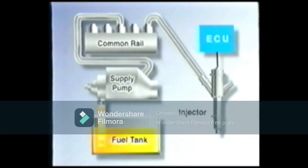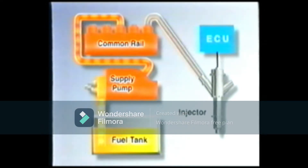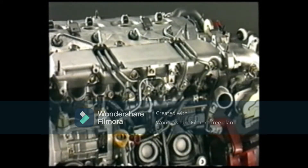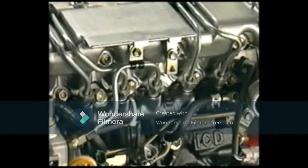The common rail injection system accumulates the necessary pressure required for injection of fuel inside the rail. Just like the EFI system of the gasoline engine, this system injects fuel into the cylinders by opening and closing the injectors in accordance with electrical signals output by the ECU. Therefore, this system can finely regulate the injection volume and timing, contributing to highly efficient operation and clean emissions. Furthermore, because this system accumulates constant fuel pressure in the rail, it does not create sudden pressure rises and offers the advantage of quieter operation.